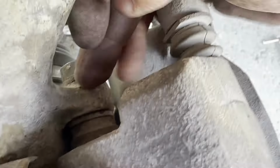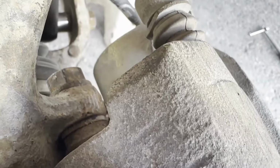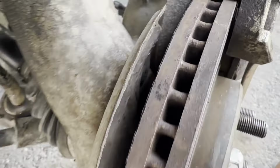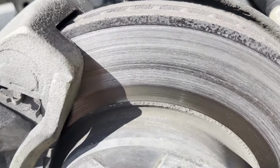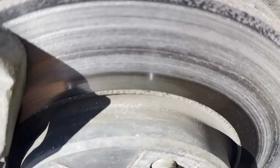The washer that I had on the bolt was actually supposed to be in between as a spacer. Wasn't paying attention when I took it apart, apparently. I've never seen one like that, but yeah, when the rotor's tight, it fits perfect. So, gotta go to the other side and do that one next, because I'm sure I did it the same way on both. And the video evidence suggests that yes, again, I failed to put the spacers in the correct spot, apparently. So we'll be fixing that here in a second.